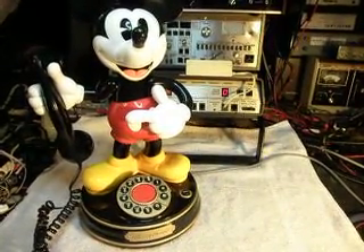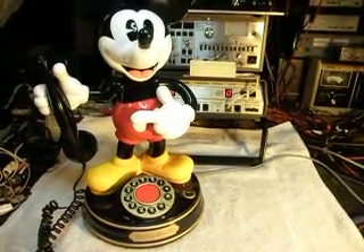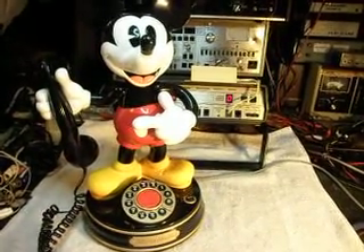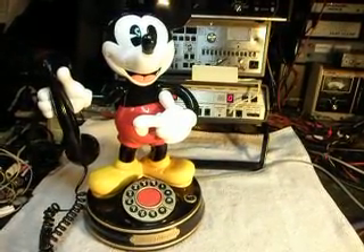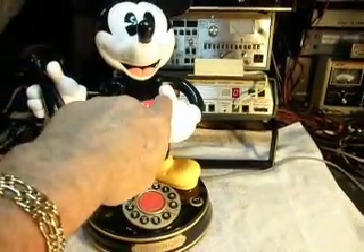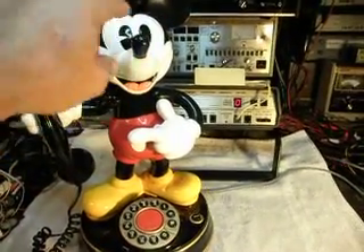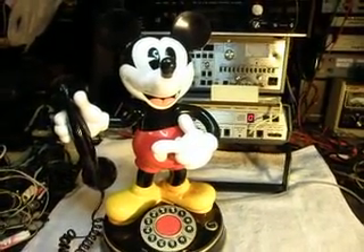Today I want to show you an animated Mickey Mouse telephone that Monica sent in from South Carolina. We've got about three videos on this telephone — the first one is an initial checkout video, and then there was a second video where Mickey was all apart, where I showed how we repaired and put the gearbox back together again. The little triangle shape on Mickey's head that goes into the gearbox — basically what happened is the guide on it was broken, going into the gears. It runs up and then goes out to a triangle, and that's where the screws go in for the ears and kind of holds Mickey together there on the head.